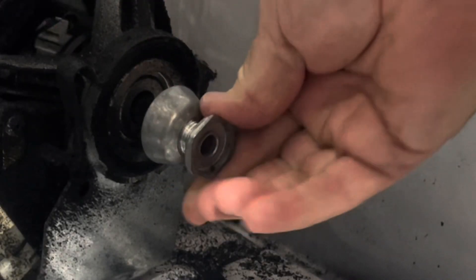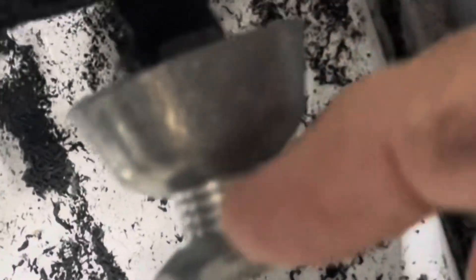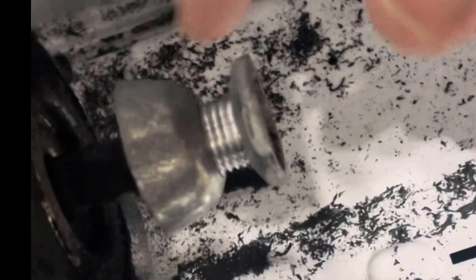The next thing I did was take a close look at the motor pulley that I had installed and I think I found the problem. I installed this belt pulley with a pair of channel locks and I'm thinking that trying to get it on there nice and tight, I squeezed it a little too hard and there's a little high area in the metal now.